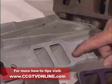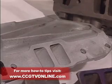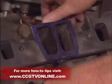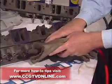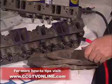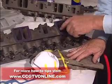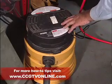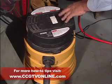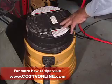We'll also want to do the same thing on this intake manifold back here to match it up exactly. For the next step we're going to need safety glasses, work gloves to protect our hands, and a particle mask because you don't want to be breathing that black iron dust. Get a shop vac with a bag in it to catch the dust and swarf while you're grinding, otherwise it will blow all over everywhere and get into everything.